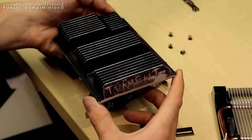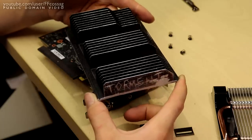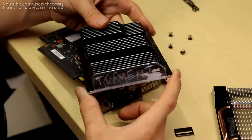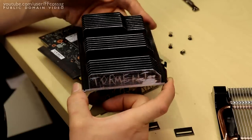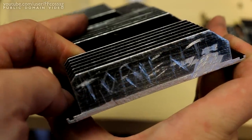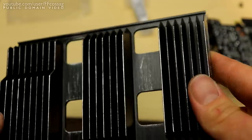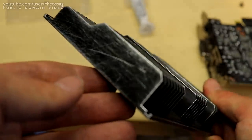To cut the heatsink I used one of these oscillating multi-tools, because rotary tools hate aluminium — it clogs them up. If you try to use an angle grinder or Dremel, you're going to have a bad day. This worked out well, though I did manage to scuff up the edge of the heatsink. So to kind of mask that, I took a wire brush to the whole thing to give it a bit of a patina look, and it turned out quite well, with some scribbles on the end to signify this graphics card's fate.